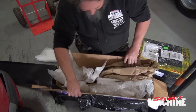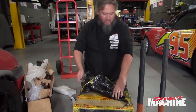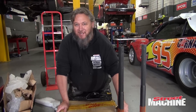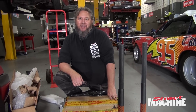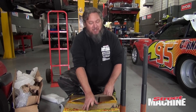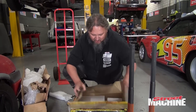There's not much in that one. Let's have a look in this one. So it's not just the axles we're replacing — we're doing a limited slip rear end. Instead of our dodgy Aussie locker. The Aussie locker has been great and worked really well for us, but it is so loud and so painful to turn corners with. You get to the drag strip, turn a corner in the pits and everyone goes, 'You've broken your diff, dude.' And you're like, 'No, that's just the way it sounds.' But it has delivered for us in terms of allowing us to launch the Volvo down the strip. We need something a bit better.